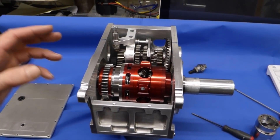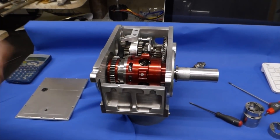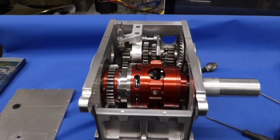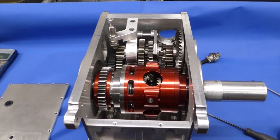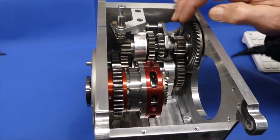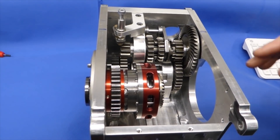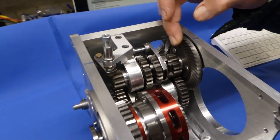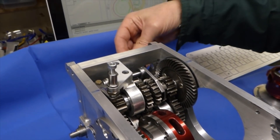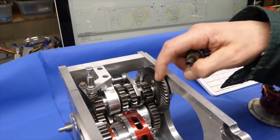With the drives for the electric, I'm going to have to go on the outside as well, so there'll be one each side. The electrics has got a limited slip diff on it as well, so that'll be able to work rather than having them both on one gear like they are at the moment. I've got these gears out of a pit bike — they're probably slightly too big, but the price is right. This differential gear came out of a nine-inch angle grinder, spare gear.